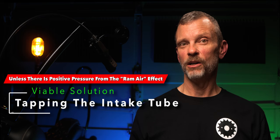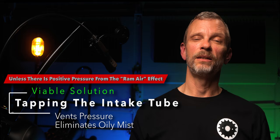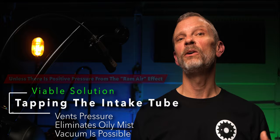So here's the second snag. That solution doesn't produce a measurable vacuum at the catch can, but it still is a viable solution because it's at least as good as venting to atmosphere because it does allow all the pressure to escape. It does get rid of any of the oil that would go into the intake. And if there's any chance that there's a vacuum that gets generated with higher engine speeds and airflow, it would take advantage of that vacuum. But yet again, I went back to the drawing board.